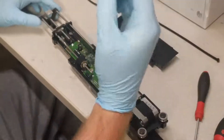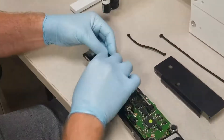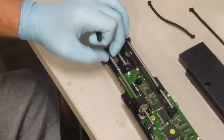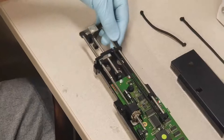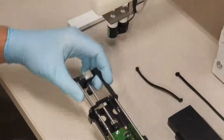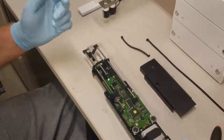At this time, we'll also use the RL height tool and put that on here. This Z-stop right here can sometimes become cracked with age or with use, so you just want to ensure that it is firmly in place and that this fits precisely like that, which ensures that this height is correct. This just makes sure that you don't bend needles or have any other sort of problems.